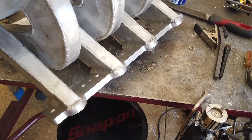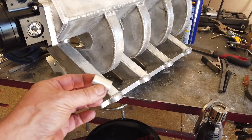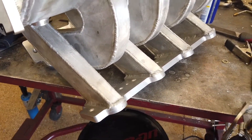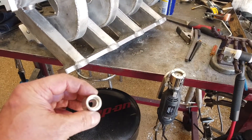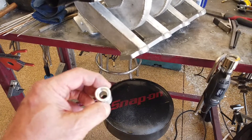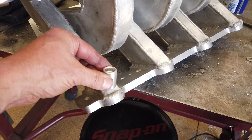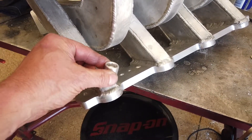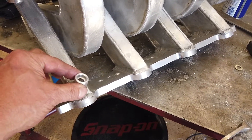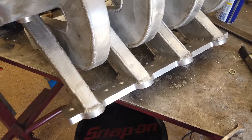There's nothing polished on my car, so I think black is going to look really nice. All I have left is the injectors — drill some holes, get the injector bungs in there. Here's the injector bungs — I just bought these on the internet, actually got them from the same people that made this flange. They're CNC, they're perfect, they match 100%, they're already the right size. I could have made these on the lathe — really not that difficult — but it was only like 30-something bucks for all eight of them, so it's not even worth it. These are gonna go right in here, so I'm gonna drill a hole and figure out the angle — they don't go straight, they go at a little bit of an angle. I'm gonna make a jig, put some sort of stud or bolt in there, and jig them all up so they're exactly the same and can't be wonky.